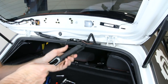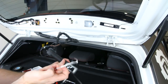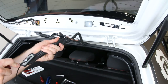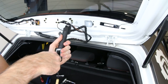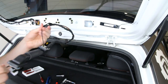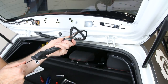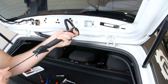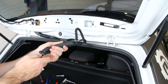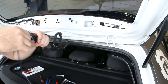What I did here is take a hook pick and once I got it in most of the way, I was able to grab the hook end, hook it through the end of the connector, and grab onto it to pull things through pretty easily. That's extremely useful; otherwise you'd have to keep trying to feed it through. When you feel things getting hung up, back out and reset — if anything doesn't feel right, something might be hung up and you could have a problem.